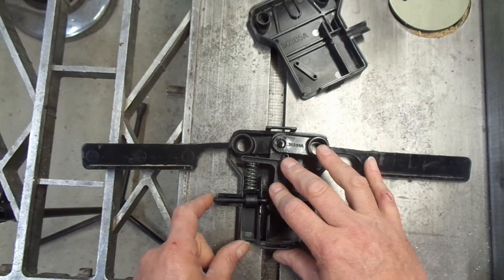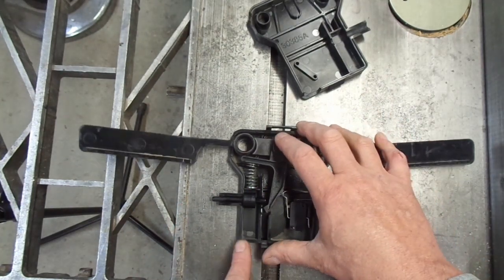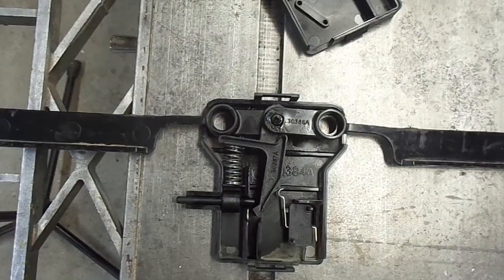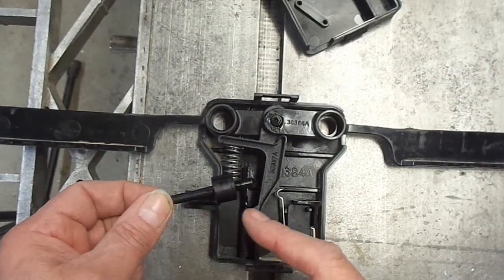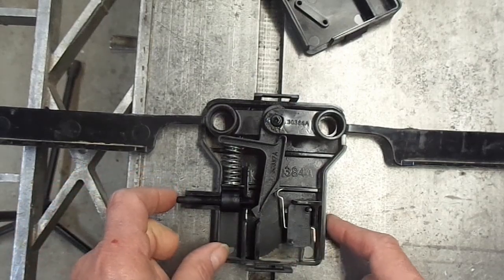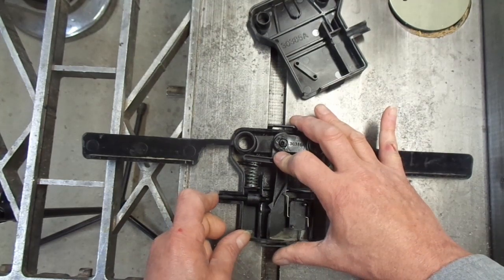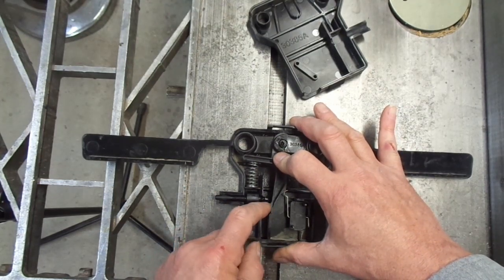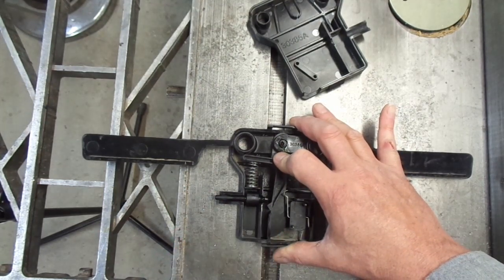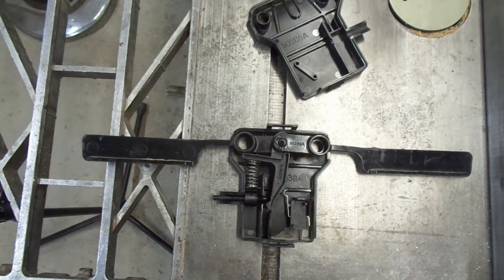I'm not sure what was wrong with this. I took the time to put some silicone on all the moving plastic parts to help free them up. I'm thinking I might take a little bit off of this shoulder here so that this button can press in a little bit further. I'm wondering if the problem is this button's bottoming out and this point here can't quite clear this septum. It's funny how all these parts have part numbers on them, and they claim there's no serviceable parts, but certainly these switches would be replaceable - you must be able to get these in the industry.